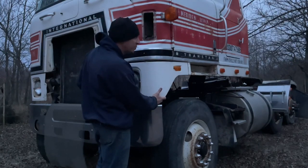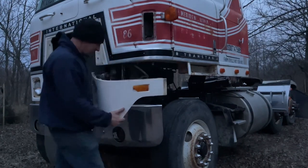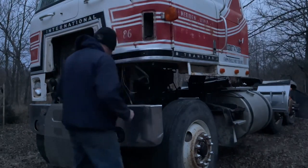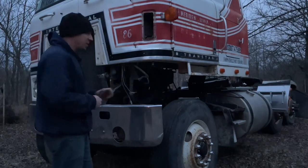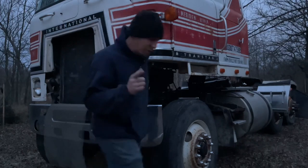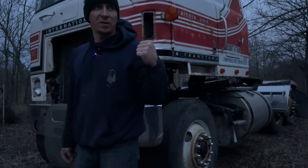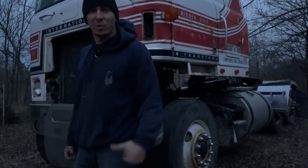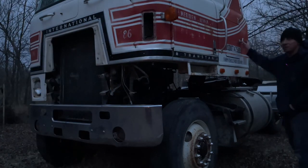I've actually stumbled onto quite a few differences between the '78 that I'm restoring and this '79 here. You wouldn't think, especially towards the end of a model year design, that there would be that many differences — but there are just weird ones. For example, the clutch on my other truck is cable operated and this one has a solid rod mechanical linkage. So why would one be cable and one not? It could be the transmission — the difference between a 10-speed and a 13-speed I guess. It's also got two batteries in it — that's $20 worth of cores.